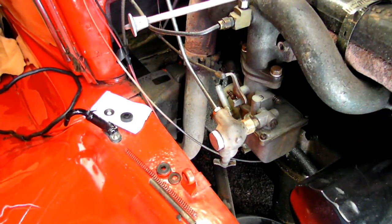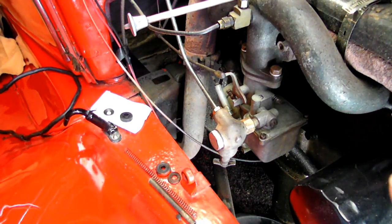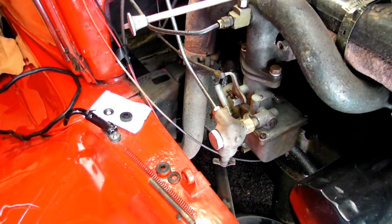What was the symptom of the truck? My choke rod was backing off — it kept turning. So it had no resistance on the choke rod. It's supposed to have some resistance. It was basically just floating around and you couldn't keep your adjustment of the choke.